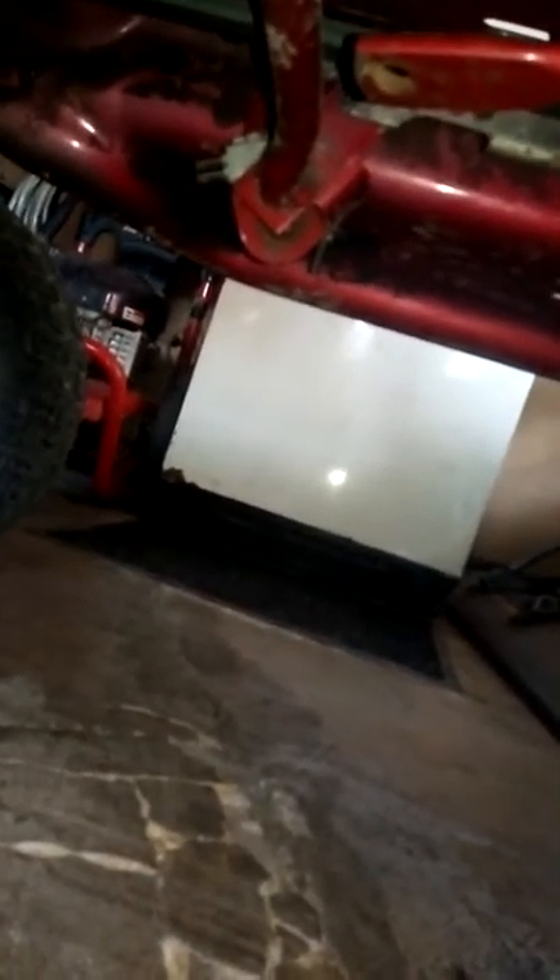Talk about expensive — this belt was more than 40 bucks, actually like 45. We were also having problems starting it, so we jumped the safety switch on my clutch pedal and just put the wires straight to the switch. Now it's fine.